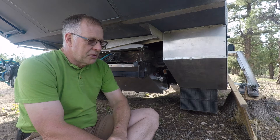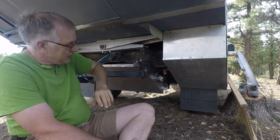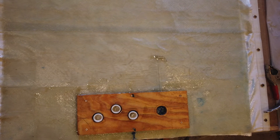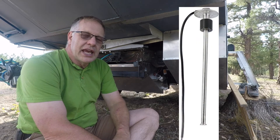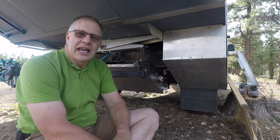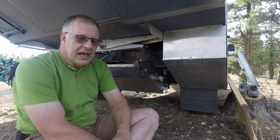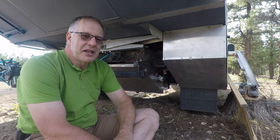Here are the ports on the tank. This is the drain port; this is the macerator port. There's a center drain port if you want to drain everything out. Water comes in the top — there are three three-quarter inch drains at the top front: one is a vent, and two are entries, one for the shower and one for the sinks. Beside that is a stainless steel float gauge that registers to a gauge on the inside telling us how full the tank is. It's a boat-style gauge with a stainless steel rod and float; resistance changes as it goes up and down, gauging the full depth of the tank. Because the tank is tapered, it doesn't read completely linearly.